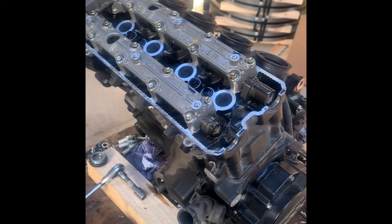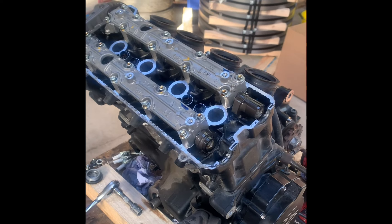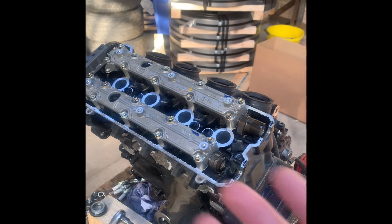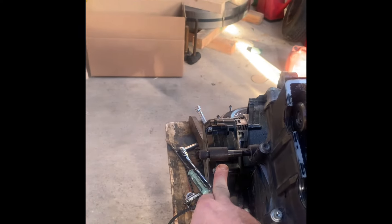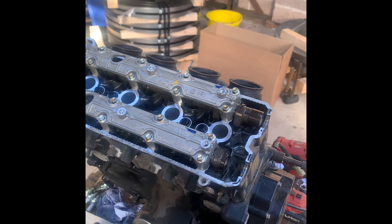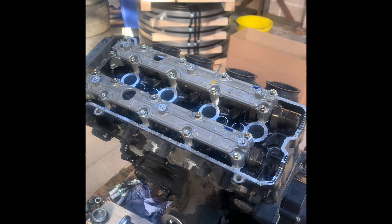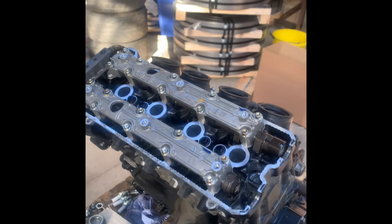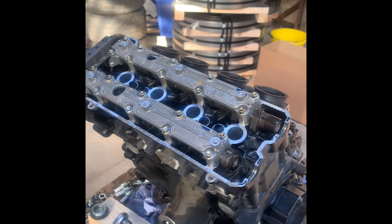Yes, it does involve tearing the engine down, but you can essentially make a new K8 with these parts, which is great as K8s are now becoming a bit of a rarity - the GSXS carries it on. There is a little bit of packaging difference with the starter system, and the newer GSXS's have a push-pull sensor on the gear change at the back of the engine whereas the early ones don't. But if you can get your hands on a 2017 to 2020 engine, you are pretty much laughing - there is a lot you can do to bring the power right up to GSXR power.